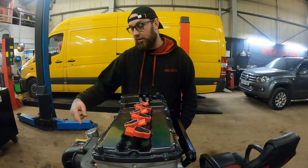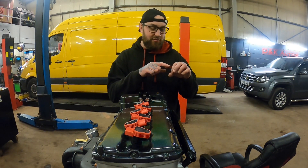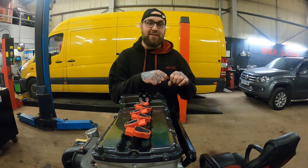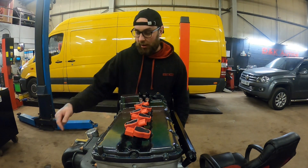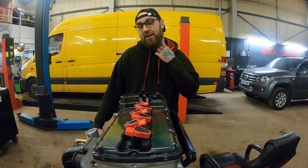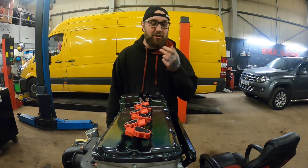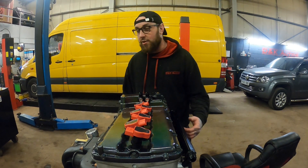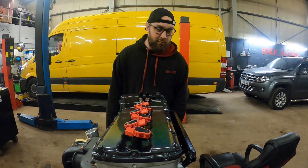There's not really much else to cover — just little bits and bobs, trying to work things out. I need to sort the coolant lines. On the thermostat housing there's a blank next to the coolant temperature sensor where you fit a horseshoe clip — I've got an AN6 fitting that goes in that plug hole to take off a coolant line. So I'll be running an AN6 coolant line to the turbo feed; the return will probably go to where the heater line is or back to the header tank. Still working that out. The next video will probably be the clutch pack in the gearbox, wiring loom, or the inlet manifold.